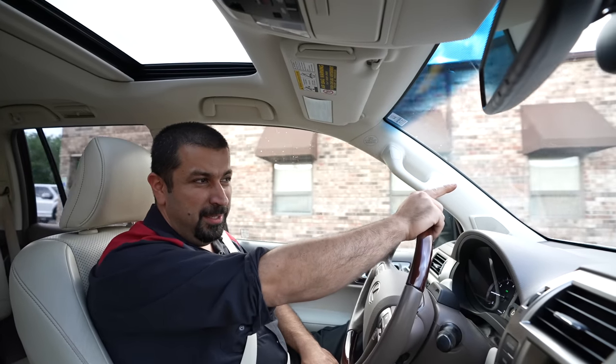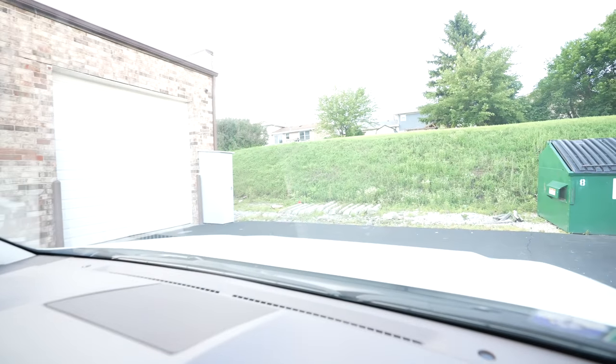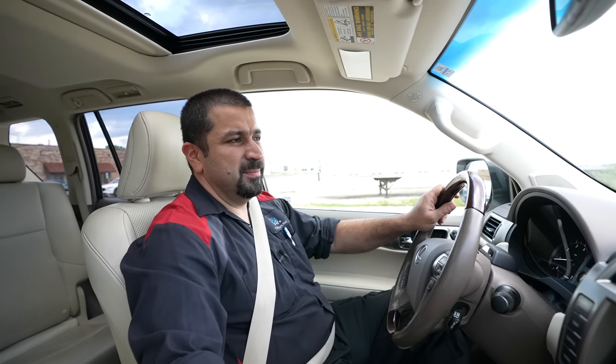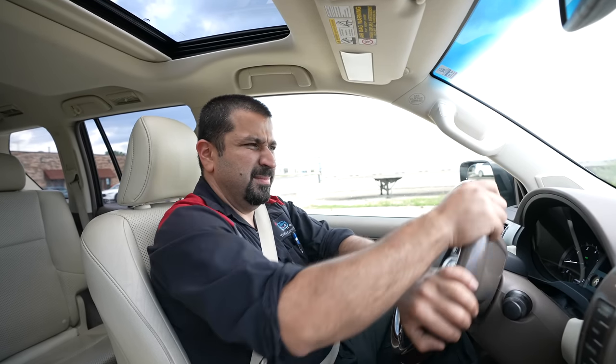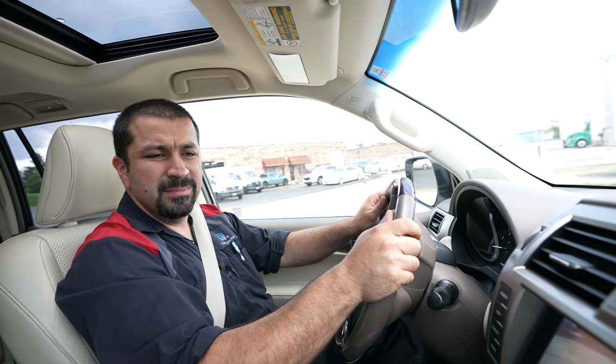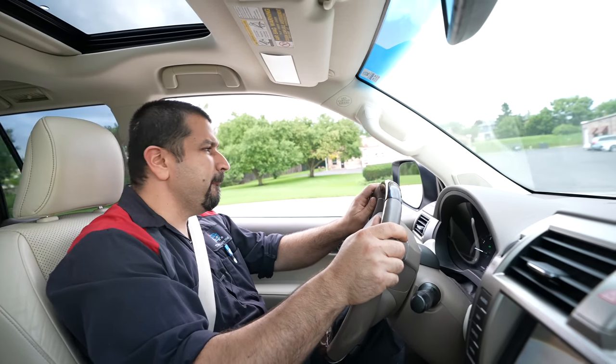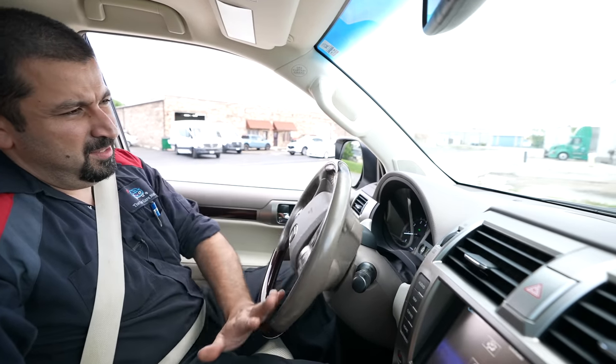Jose, we're gonna go up this hill — do you think that's a good test? Jose said no — he's done with off-road adventure damage for now. Let's find an open spot and try to hear the noise. If you go in reverse at full lock, you can hear a scraping sound. I hear it from the front, but the weird thing is it only happens in reverse, which is kind of strange.